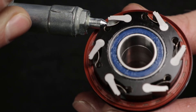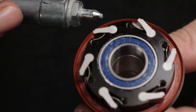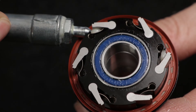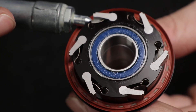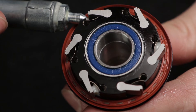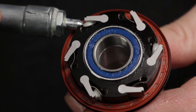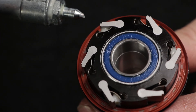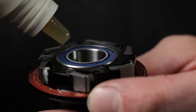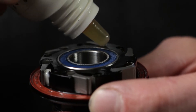If you're using a grease gun, simply fill the cavity between the pawl and the spring. You can do this with three pawls in an alternating pattern, or all six pawls for a quieter ride. As the freehub spins, the grease will migrate between the paws. Make sure the interface between the pawl and the pocket is lubricated — a dab of oil on the top of each pawl will do the trick.